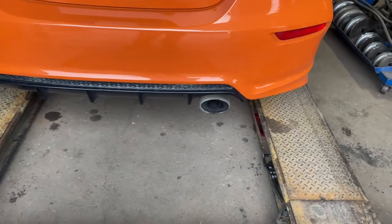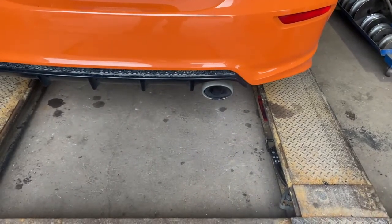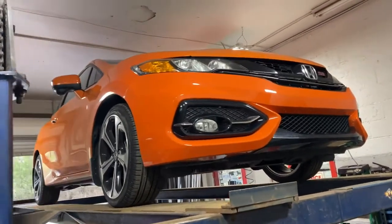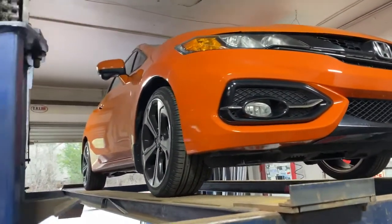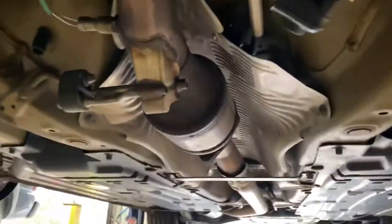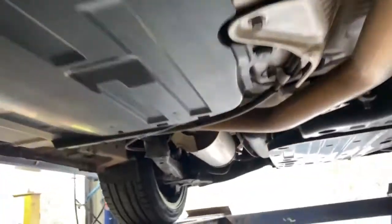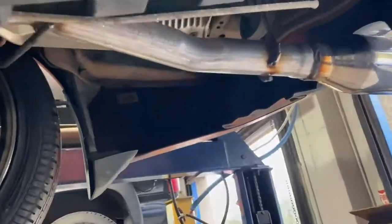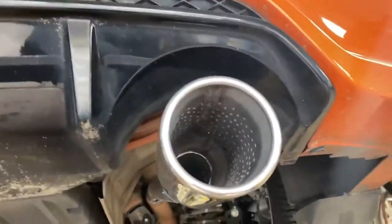This is what it sounds stock. So now it's a 2014 Honda Civic SI — you heard it coming in. This is what we got done on it now. There's the original catalytic converter, there's another one up there somewhere at the manifold. Then it's got two and a half inch all the way back into a resonator, and we did a muffler delete. Put a four inch tip — a little bit resonated tip — to give it a nice tone.